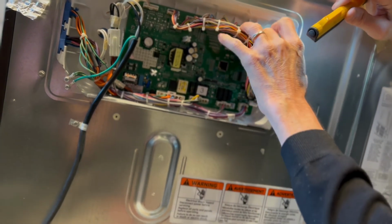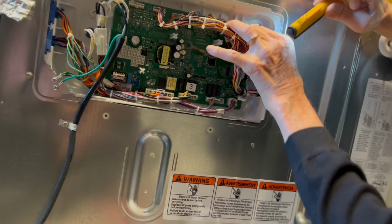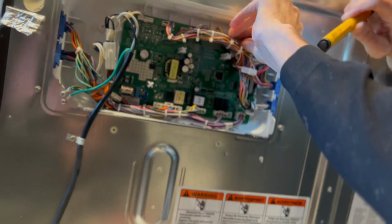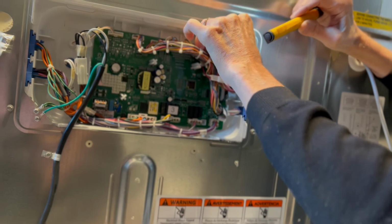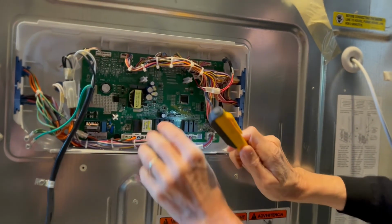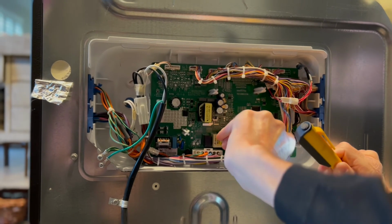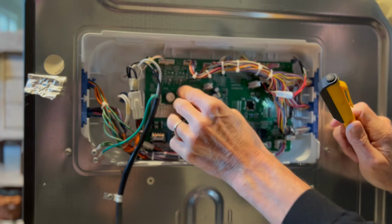In this particular refrigerator, the problem was that the cold air just couldn't get into the fresh food section because of some ice that had accumulated. Because instead of having the refrigerator at 38 degrees, they had it down at around 32 degrees, which is where water freezes. And that had built up a big ice block that prevented the air from flowing. So on this refrigerator, to fix it, all we had to do is an old-fashioned defrost, which we'll cover here in a minute.